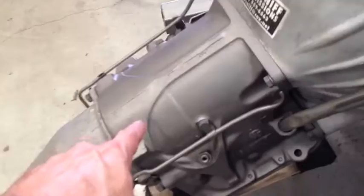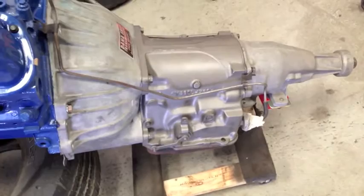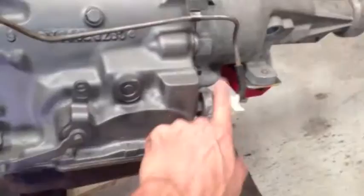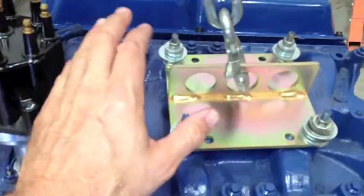The FMX trans is painted with cast blast silver so it looks like it came out of the plant. Ford actually released these cast iron and they just started rusting — they weren't painted when they came off the line, so this looks like it just came out of the factory and it will stay that way. There's the kickdown right there, shifting linkage right there, and this is the modulator for the transmission — this connects to vacuum on top of the air intake.